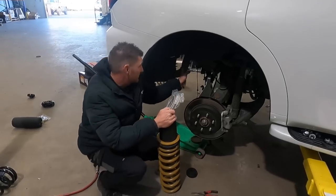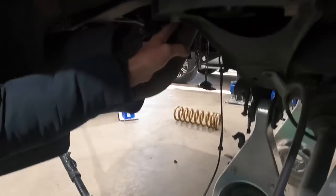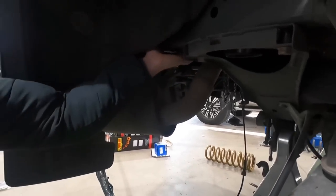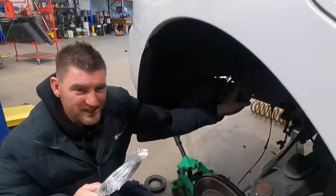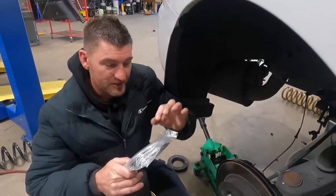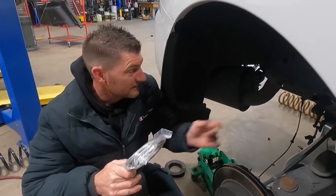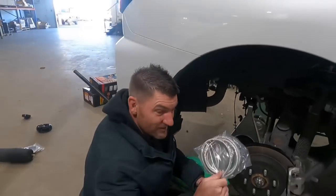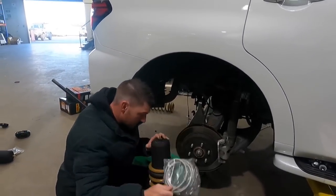This particular side is a good improvement because we've had a lot of issues with exhaust heat with the normal lines. We've been hiding the hose behind the chassis and cable-tidying on top, but with these Patrols they produce so much heat at the back from the exhaust that the plastic line goes soft and it can blow holes in it. Now we're running the braided line, so it's just never going to be an issue.